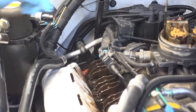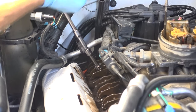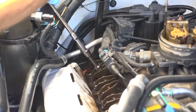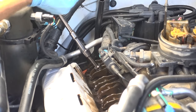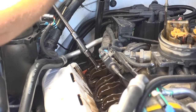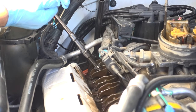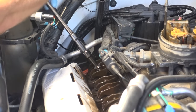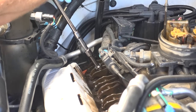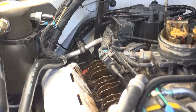I just got done adjusting the exhaust valve, and now we're going to adjust the intake valve. I'm basically going to loosen it until I hear the clacking — there's the clacking. Now it's not clacking anymore, so we're going to give it three-quarters of a turn. That's one, two, three. That one should be adjusted perfectly. Now I'm going to take my stethoscope and listen.